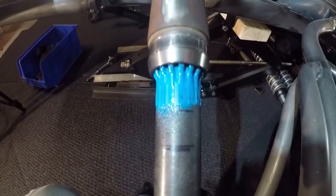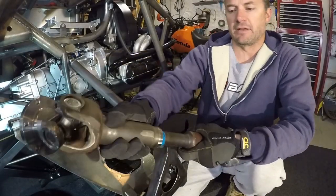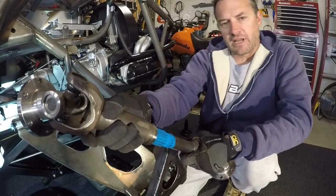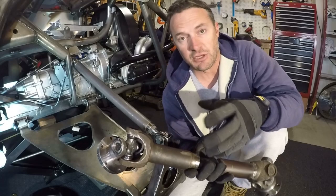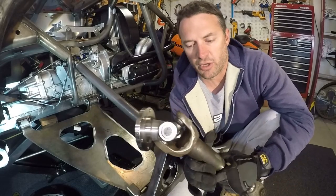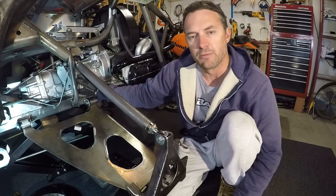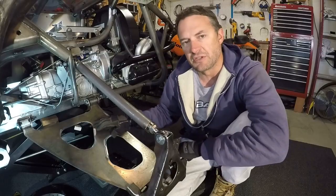That has to happen lightning quick. I can feel it right now — moving this in and out is a piece of cake, but if I put some twisting force on there it actually adds a lot of torque. If you've actually got an engine twisting on this thing, it makes the spline really hard to compress, and then that force is pushed up through the drive shaft and ends up pushing on the side covers and the bearings on your transaxle, so it'll start prematurely wearing them out.